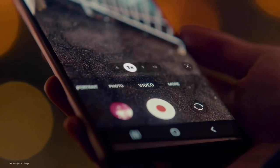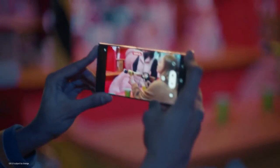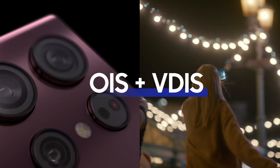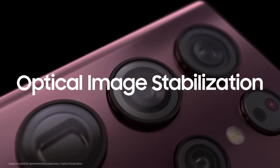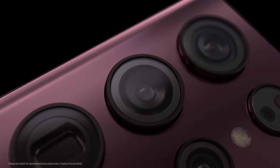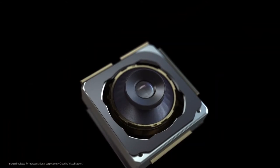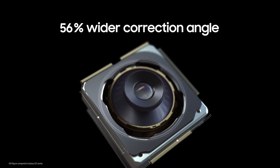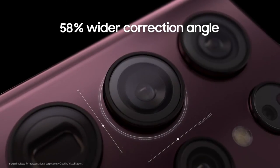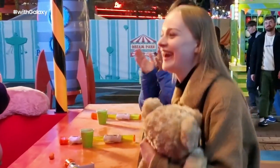To provide clear and stable night video, Galaxy S22 Ultra employs an intricate dual-track image stabilization solution with OIS and VDIS. OIS compensates for camera shakes by physically moving the lens in the opposite direction of the motion. Galaxy S22 Ultra's OIS hardware has a 58% wider corrective angle compared to its predecessors, which allows the camera to neutralize larger shakes for smooth recording.